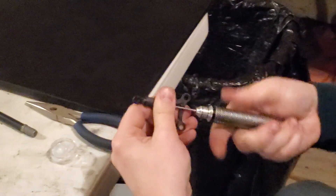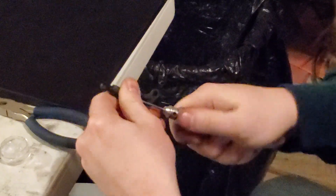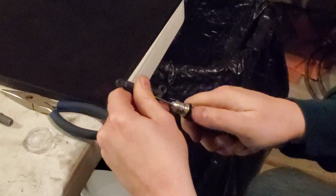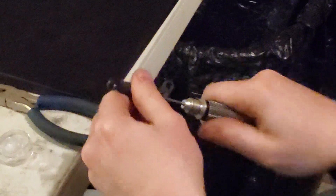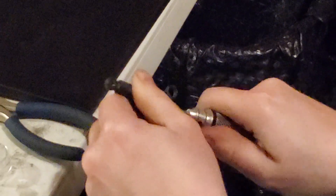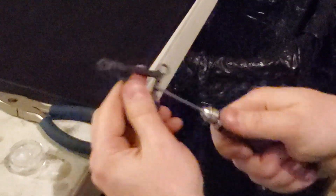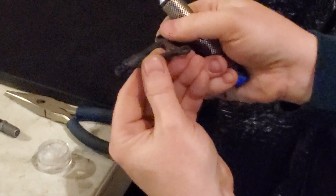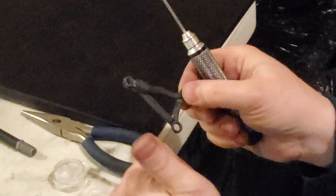The upper wishbone, the upper arm. You will end up going a little bit further, but the trick here is you're not threading any more screw into the ball end — you might be threading a little more into this arm, and it can take it. It'll want to stop. Pretty close — that might be enough. Keep going and oh, it won't go anymore. That's the end. And that's easily like 4 degrees camber at that setting, so it's got room to move. Good to go.